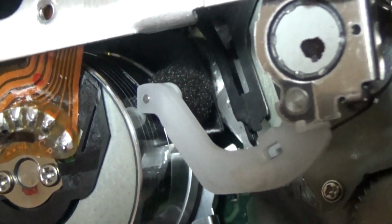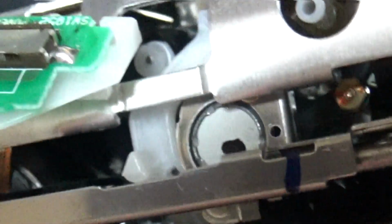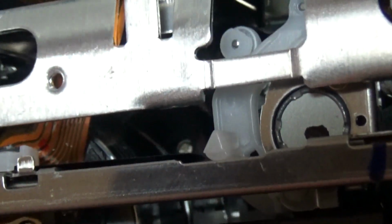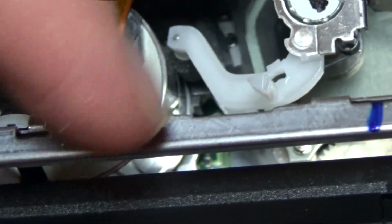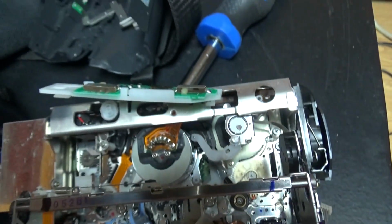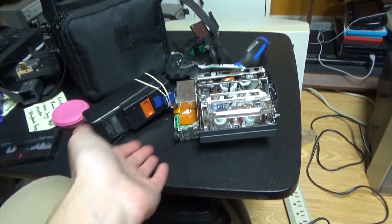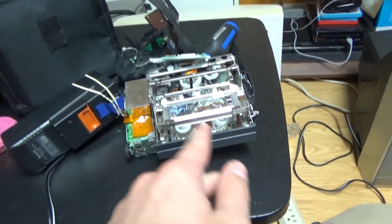And here you might have already noticed it, but I forgot to talk about it. There is an auto head cleaner. And it seems that it works differently from regular VCRs. So usually when the tape guide loads, it just pushes against the drum while it's spinning, but now it's when it ejects. Right now it is pinching against the drum, the heads, and while the drum is stopping its rotation, this is touching it and cleaning it. So it does not work exactly the same as on regular VCRs,